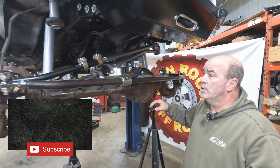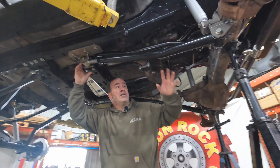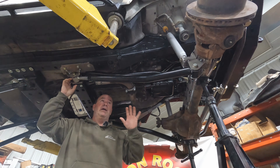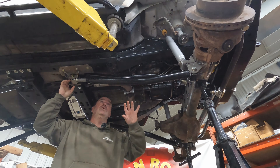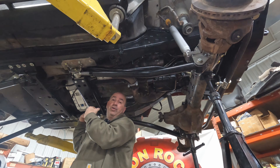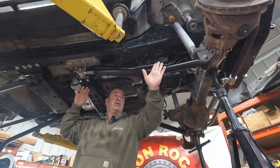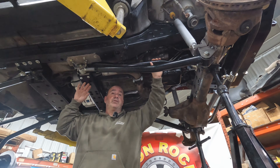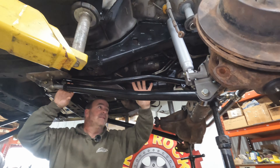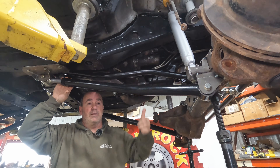We're going to talk about our control arms and mounting system. All of this is set up specifically to make this easy for you in your Cherokee — everything designed and engineered to work together. We've got a whole new crossmember system, a three-piece crossmember so you can still drop that center section out for any transmission or transfer case work. The control arms are designed to get you as much tire clearance and up travel as possible, given that there's not a lot of room in a Cherokee. Everything has been bent to clear as much as possible for maximum up travel.